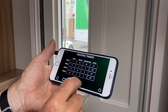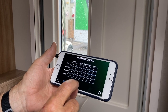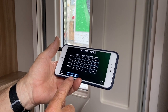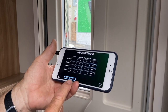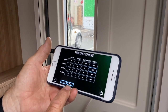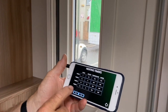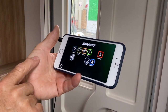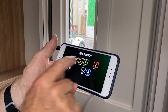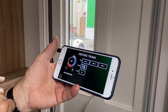I'm just going to turn them all off now. You've got a save/load option — if it's not registering up on the panel, you may have to load it back to the caravan. Just press the button and it'll load the information back onto the van. I've gone back onto manual now, so the heating is going to be controlled from the panel at the top.